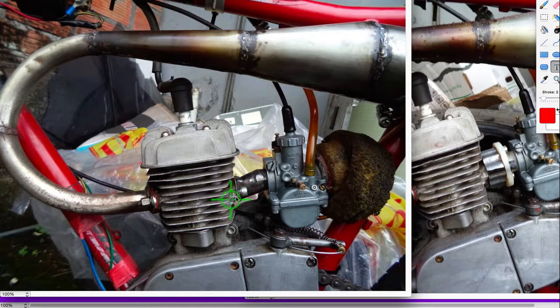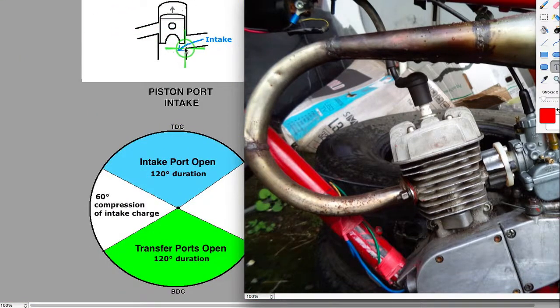The only thing is the porting for the intake port needs to be changed just a little bit. It probably varies from engine to engine. You really need to look at my video about how to find the port durations and become skilled at doing that. Then you can accurately measure what your intake is and know how much to change it to bring it to where you want it. On this test, the 120 degree intake duration was just right on the money — it was excellent. Good low end, good top end. You can't ask for more.